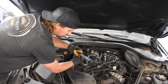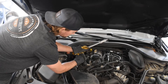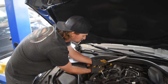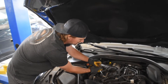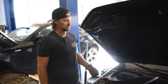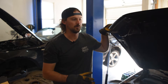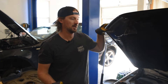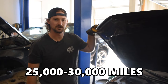You can use spark plug grease or some type of anti-seize on it if you would like. We change our spark plugs pretty frequently. On something like this B48, we'll probably change them every 40,000 to 50,000 miles since this car doesn't have any performance modifications. On the ignition coils, I'm not changing them this time — we'll probably change the ignition coils every 80,000 miles. On something like our N54s, since those are pushing pretty big power and we're running the two-step colder spark plugs, those only last probably 12,000 to 15,000 miles, and we'll do the ignition coils probably every 25,000 to 30,000 miles on those.